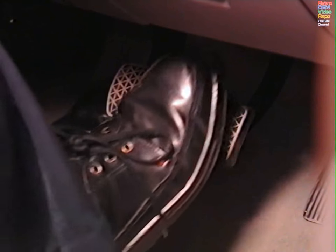Okay, that's the parking brake. What about the foot brake? We call it a service brake, Robert. There are checks that are conducted on the service brake from inside the vehicle. The only bit of the service brake that I can see is the pedal — so what sort of checks can you do from inside the vehicle? From here, we can operate the service brake, and we would be checking for the amount of travel and for fouling. Just simply depress it and assess that travel. If the pedal sank right down and there was no reserve travel, then it would fail. During that operation, you can feel for any fouling and assess whether it's acceptable or not.